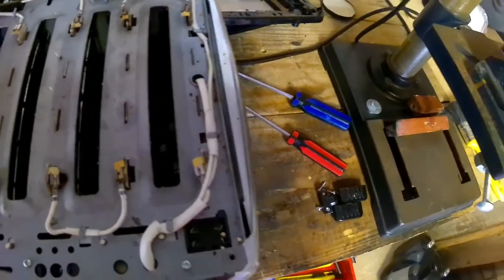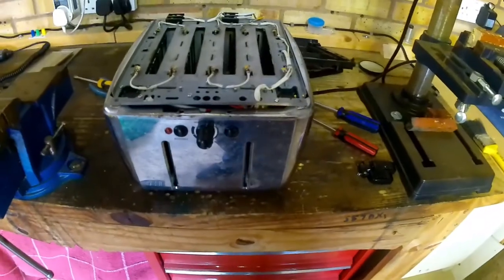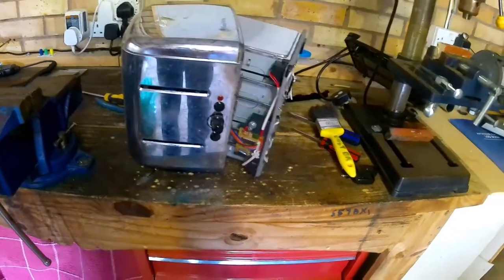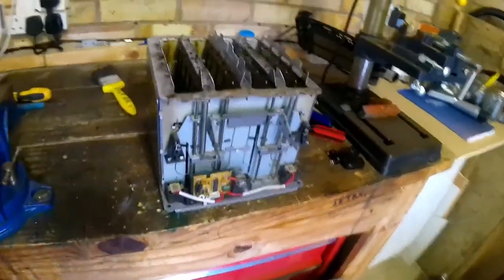These are the terminal blocks, so I'm just going to dust this out. I've got an old paintbrush I use for getting rid of crumbs. Then I think you have to remove the front knob here, which I think is a push fit. It just basically lifts out, but there's a connector here on the control board you have to unplug like that, and then the whole mechanism - the guts - will lift out. Full of crumbs - let's get that brushed out.